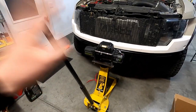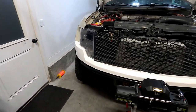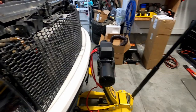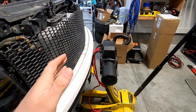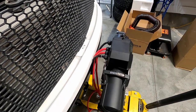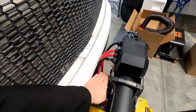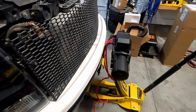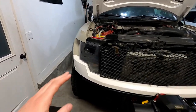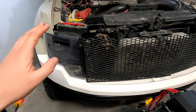I'm kind of worried about leverage. I could lift up the winch on the plate, maybe add a riser, but right now the wires are running into the valence and the bumper, which is not super ideal. We have about four inches between the winch and the bumper that isn't really necessary, so I'll have to figure out how I want to handle that. What I want to do right now is find a path from the battery down to eventually reach the winch. I do plan on using some Anderson connectors.